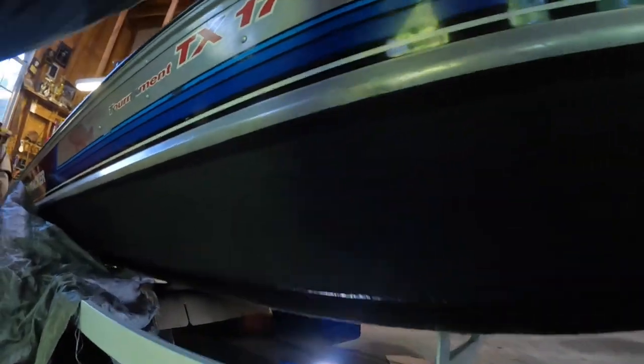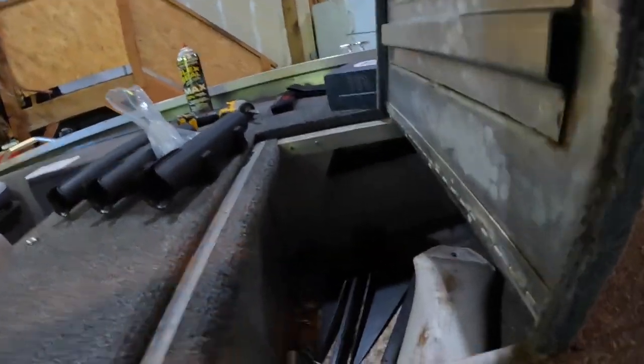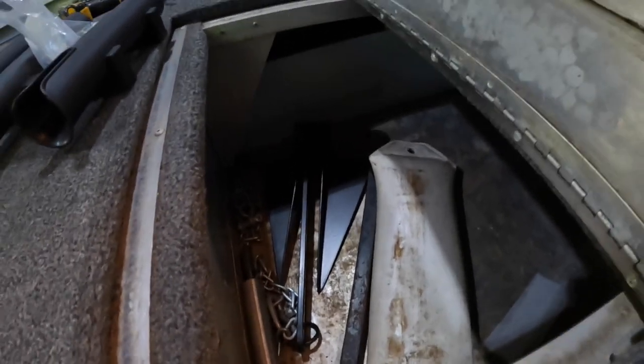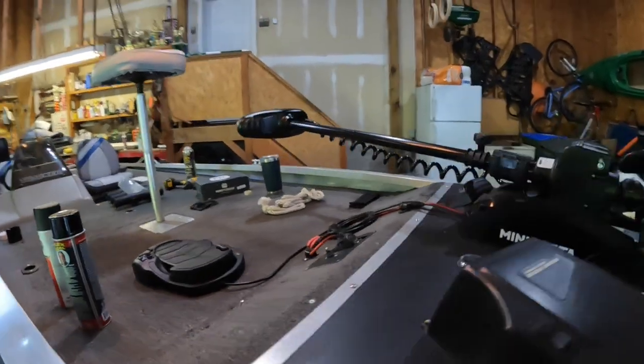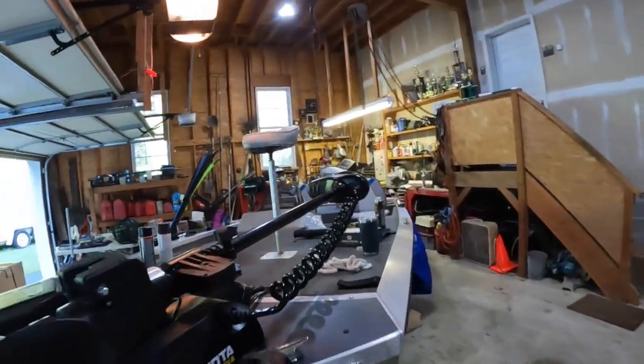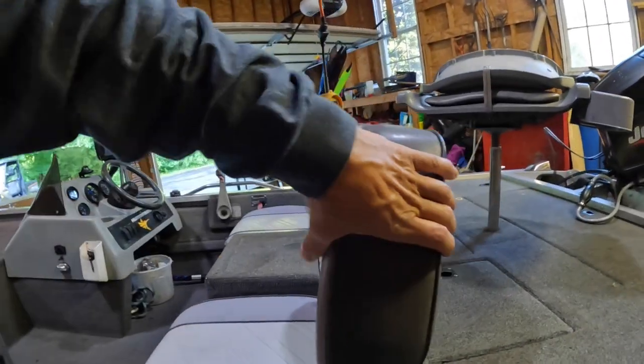One of the problems that we have here is that there's really no great way of sealing that from the inside on that keel. If you look in some of my compartments, the keel is not exposed at all, which is great because it makes for a nice boat as far as the compartments go. But I only have a few points of exposure without tearing the boat completely apart. And even here, you can see I really don't have even exposure here.